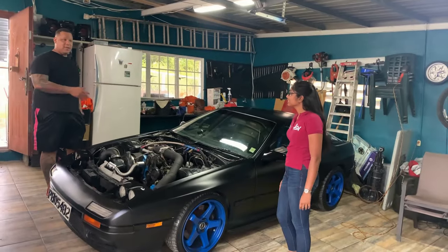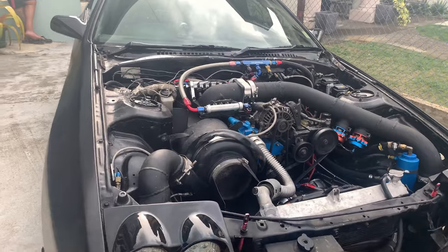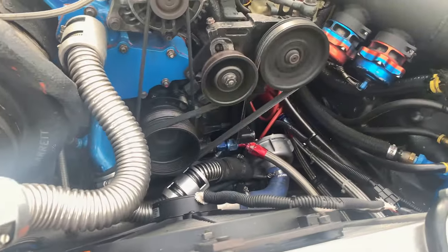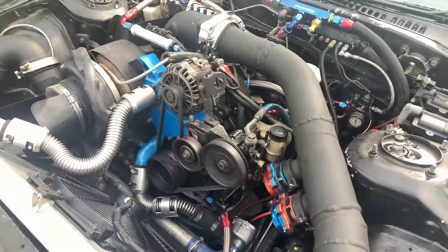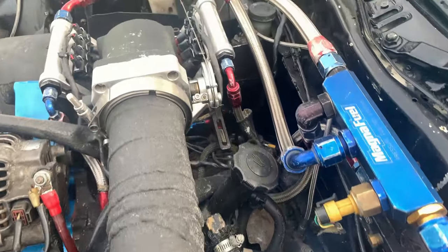So I know most of the questions everybody is saying, turbo bigger than the engine, but yeah. It has a lot of turbo for this engine, guys. But rotaries love those big fellas, they love to breathe. The build is a series 6 engine, stock rotors, no clearance. We're just using original Mazda parts, and Alex Lopez unbreakable seals inside. So you operated the seals?